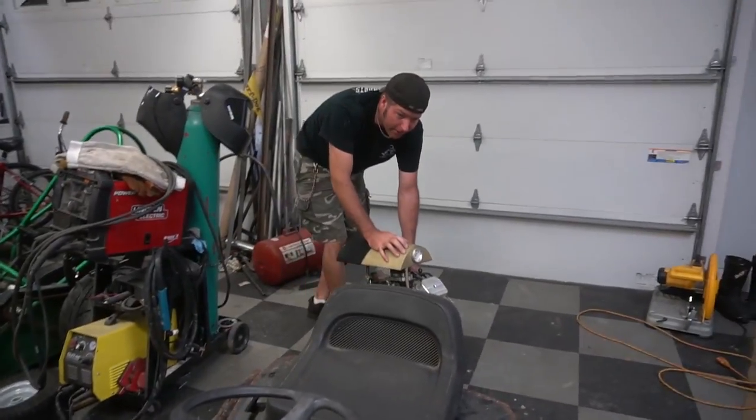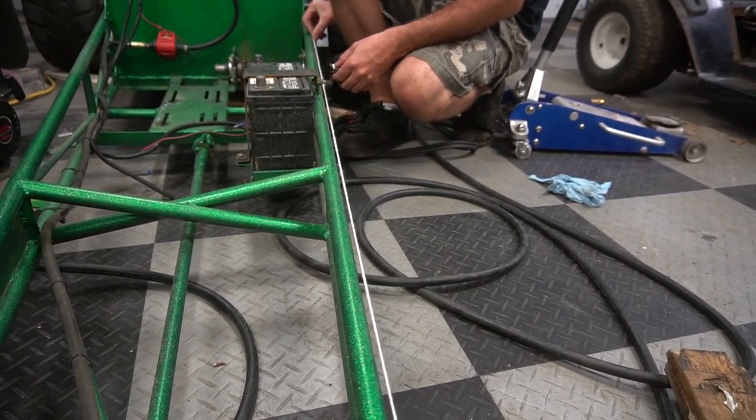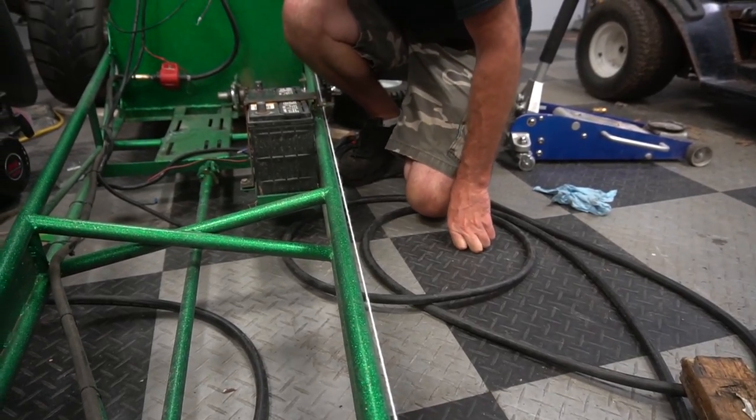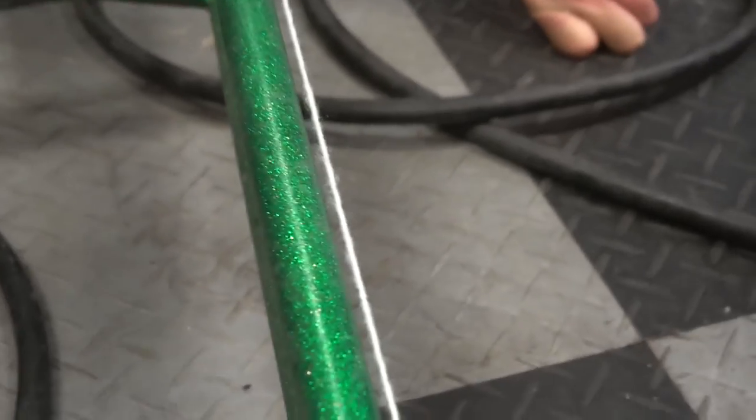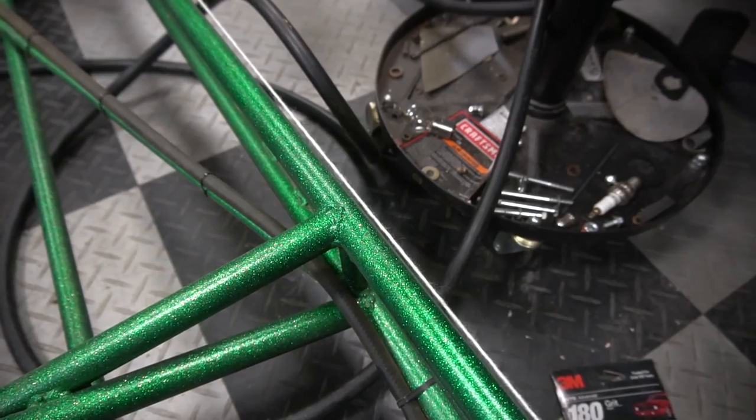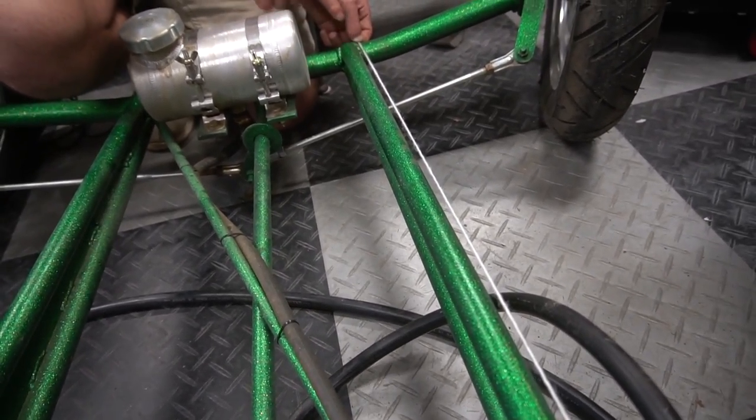If we do this and we don't do it, I don't want a lot of disappointed people. The engine is off the rail right now because the torque converter is on the Harley-Davidson. And we're also waiting to talk to some kind of expert about the frame on the drag rail, too. On both sides, it's bent a little bit like a horseshoe. It's not bad when we use some wire and stretch it from the front of the rail to the back, and right where the impact is, it's got a bend in it. It's probably a sixteenth or two of a bend. But I know that on drive shafts and stuff, if the integrity is compromised, it can just fold up like nothing. So we would like to talk to some experts and make sure it's going to be safe to run the rail again, because the frame has been compromised.